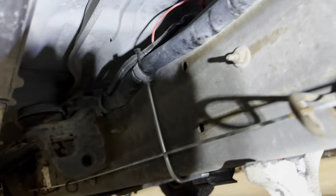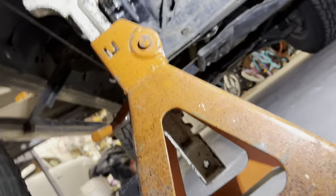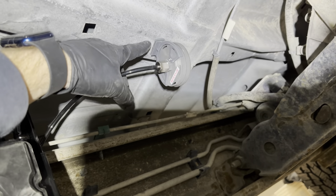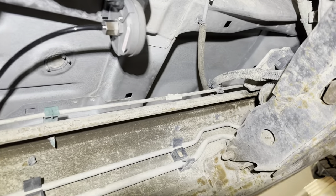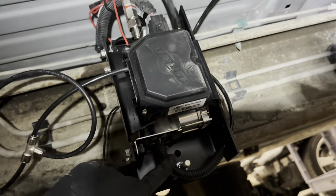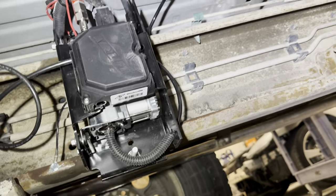We just put a U-bolt, as you can see right there. You can see my wire loom and that red wire that goes up. I ran everything in wire loom just because that's how I am. Put some wire loom around this — it's got a connector on it. I drilled a 3/8 inch hole and just mounted this sucker right up here up high. I think it's got a little filter in it, so I wanted to have easy access to it. I put a little wire loom here on the bottom. You can mount this in any direction — you just can't mount it upside down and you can't mount this connector facing down. Any other direction is fine.